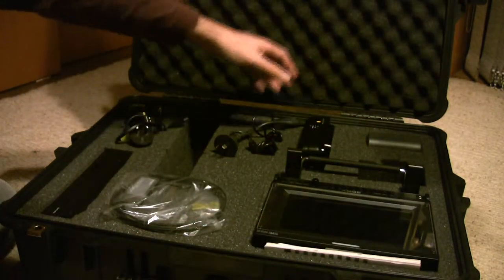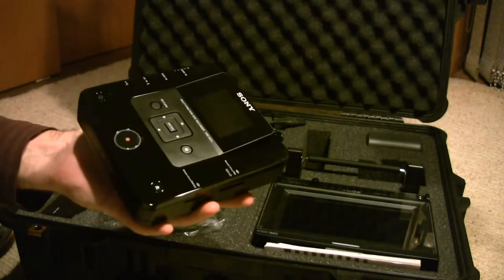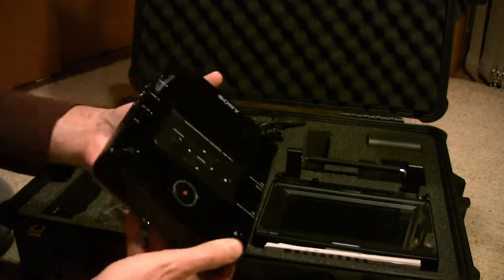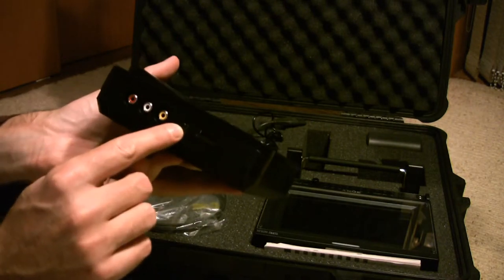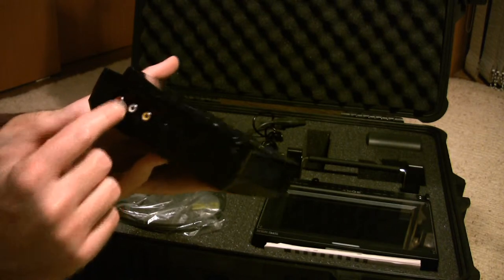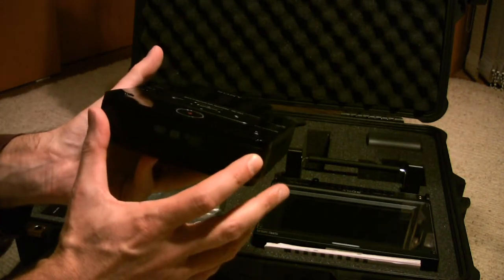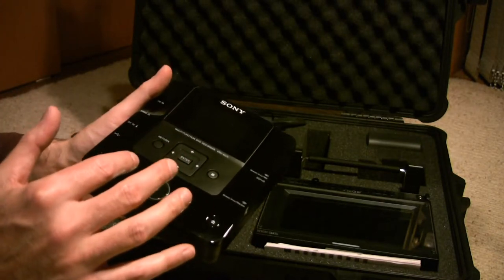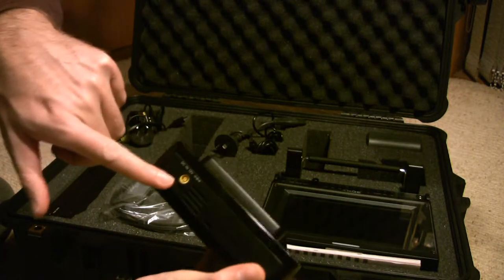The second thing we move on to is if you want or need to do a live DVD record out to give to your client as soon as you finish the shoot, we've got a little Sony portable DVD recorder. So you can take either a DV in direct from a camera or composite video with analog audio as inputs from the camera. It's got a little tray that comes out when the power is connected to it. Pops out here, put your DVD through it, and I'll go through some of the menu selections shortly on this. But it's a great little device that runs off a little 12 volt adapter.